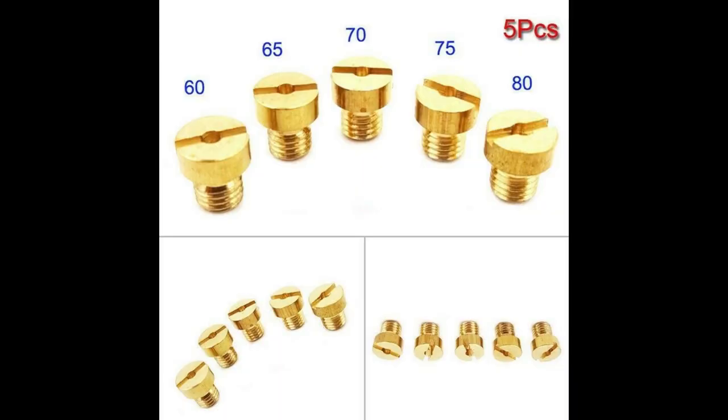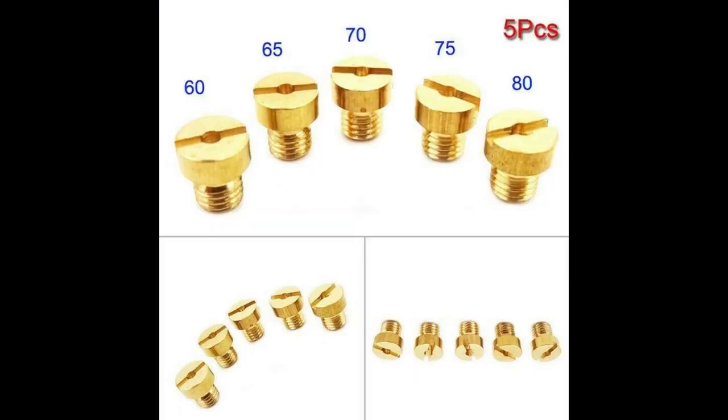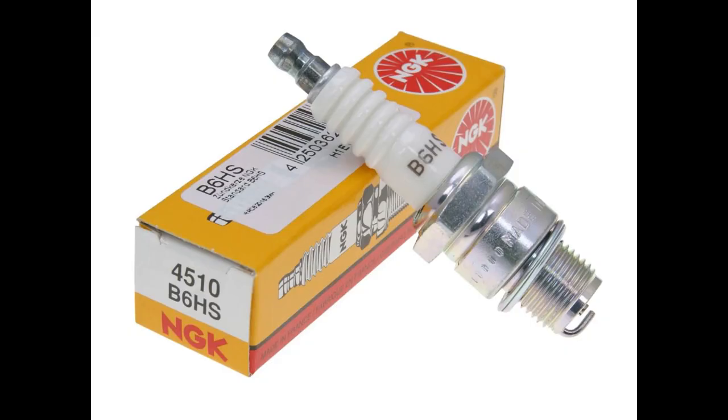Next up is a jet kit — a 5 millimeter jet kit. Get number 60 through number 80. Some kits are pretty limited, so you might also want to consider getting a pin vise and drill set with small micro drills. That way you can fill the jet with solder and then use the pin vise to drill it out to the dimension you need. The stock jet is a number 70 that comes with most carbs. I'd recommend you try a number 65 jet — that will get your engine running its best, but you really don't know until you do a plug chop.